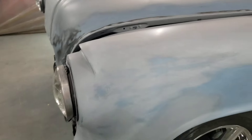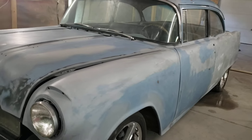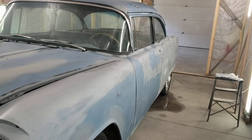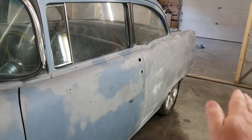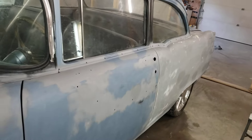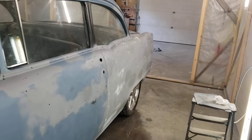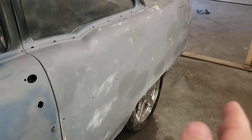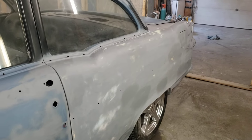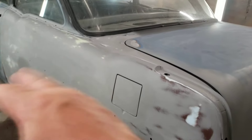Filler works just fine — follow the rules. Lots of bite, put your filler on, sand it out, a bit of primer, sand it out, do what you've got to do. Some guys like to creep up on it — I find that takes a long time. You fill it and block it and fill it and block it, and you keep going. For the first go, don't be afraid: push your thin layer on, push it into the metal really well to get it to stick, and then flood it on the second coat — put way more on than you think you'll need. It's all going to end up on the floor, but you're going to get there faster. You'll still have to do it one or two more times lightly and block in. If you try to go light and put the least amount on, you end up putting thin layer over thin layer — you're going to get lost in the waves. Put lots on, learn to block.